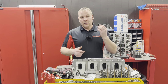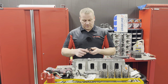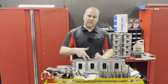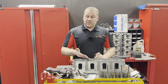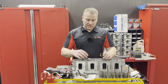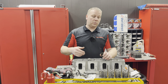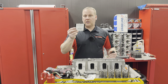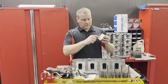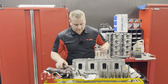At the end of the day, you have the valve spring height micrometer. And this basically tells you how tall the distance is from the seat where the valve spring sits on the locator to the top of your retainer or bottom of your retainer, and how far that valve spring is crushed inside of there, which dictates why BTR and many others provide you with how much pressure they are at different heights. These are the heights, these are the pressures. So it's a super cool, easy process.